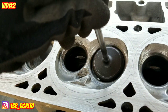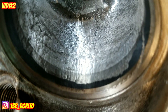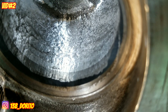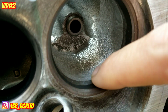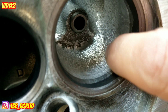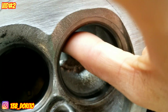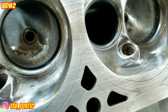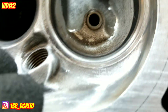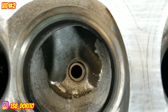Quick update after doing the ball cut on all of them: make sure you can see the aluminum blending with the seat all the way. Run your finger across and make sure your finger won't get caught or cut on the valve seat. Make sure it's nice and flush, nice and smooth — the transition should feel like it was never there.